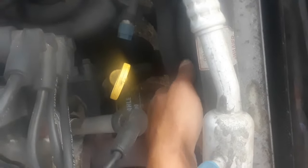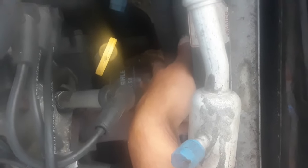And here's your oil filter. So if you ever need to service a car, get an oil filter and an oil filter wrench at Midas or wherever you shop. It just turns off — put your bucket at the bottom. Here's your drain plug, remove that.